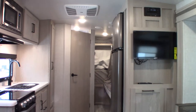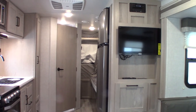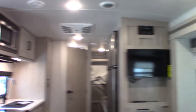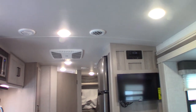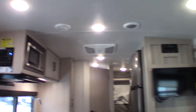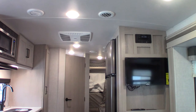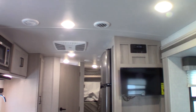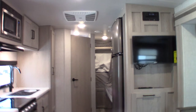Thanks for purchasing here at National RV Detroit. Remember, you have to inspect the roof every 90 days — that's what the manufacturer states. When you go up on the roof, be very careful. Check the lap sealant for separation or cracking — any way water could get in. Look at the attachments on the roof and make sure vent covers aren't damaged by branches or road debris. A good inspection every 90 days and this thing will be bone dry 20 years from now. Trailers have to be inspected and maintained as needed; you may never have to reseal it, or you might need to reseal a spot in a year since they're all handmade.